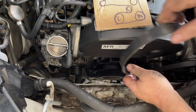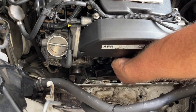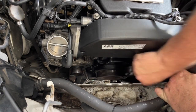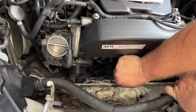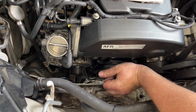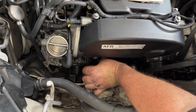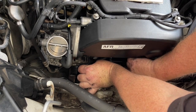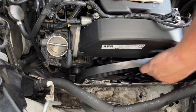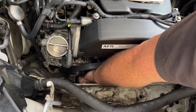It's fairly easy to get it around the crank. I'm going to try and feed it in — often with this tensioner there's just not enough room to feed it in and you need to take a little bit of tension off just to get it in there initially. I'm putting a 13mm spanner on that bolt and pressing down to take that tension up. The smooth side of the belt goes towards the tensioner, so I'm just going to feed that in there. I'll go around the aircon pump at the bottom and around the crank.